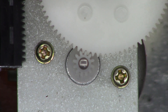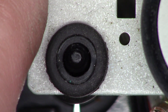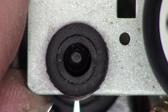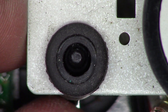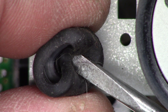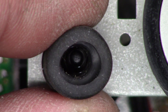Let's put the covers back on and fire it up. One thing I noticed before reassembly is this rubber bumper — it's what allows the mechanism to float and acts as a shock absorber. This one had been assembled incorrectly and wasn't allowing the mechanism to sit flat. I had to pull it back apart and straighten it out — it had gotten folded up inside. That could definitely be a contributing factor if the mechanism wasn't sitting flush and the disc was scraping.